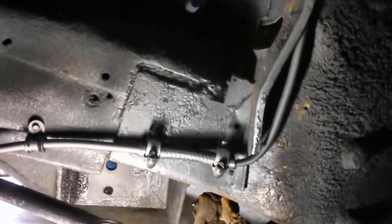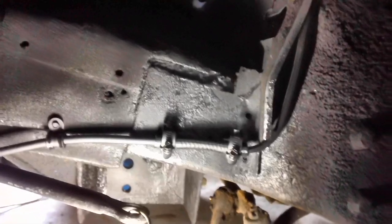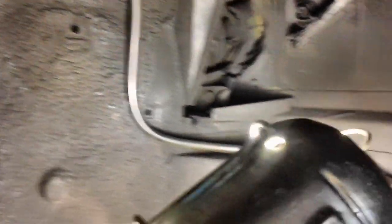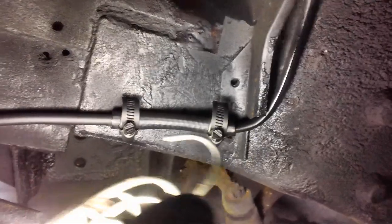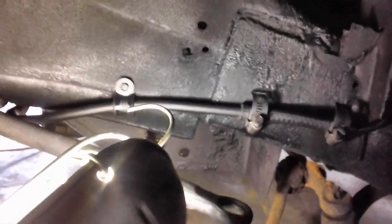Right now I'm putting the finishing touches on my gas line — giving it a few touch-ups where it got scraped up. I still have to put a little undercoating over the top of it. The only thing that got done a little wrong is this loop was a little too high — it should have been down at this level. I'd have liked it lower but I'm not going to redo it, that was very difficult to bend. Right there is our rubber hose which the manual calls for, and I ran out of line so I had to put a short piece of rubber hose there.